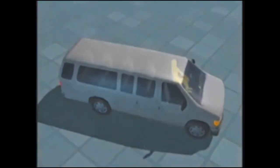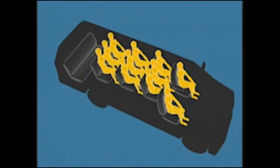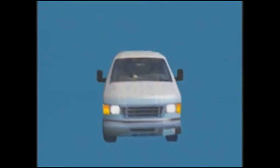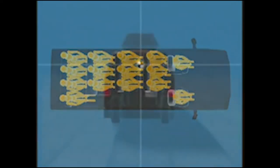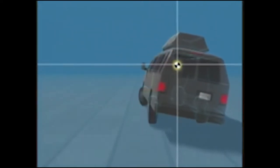When loading the van, fill the front seats first. If possible, have passengers and cargo forward of the rear axle. If the van is loaded to capacity, remind yourself that the center of gravity has shifted and the van will handle differently than when driving alone or with just a few people. You should never have more than 15 people riding in the van. Avoid placing loads on the roof, as this also increases the risk of rollover.